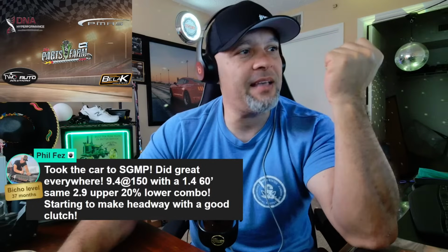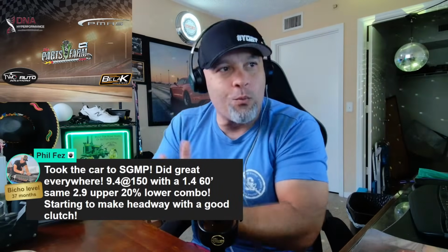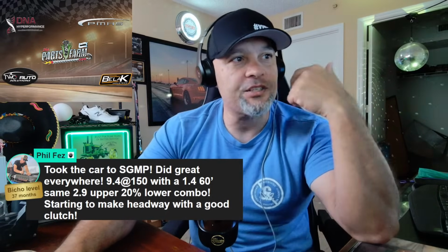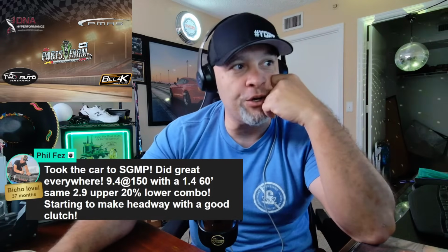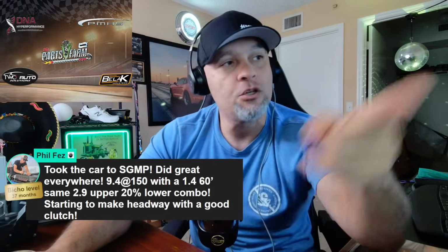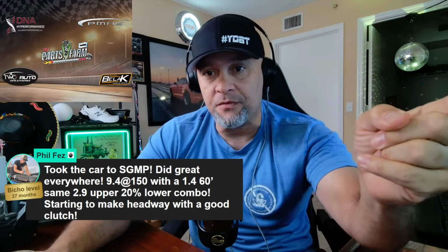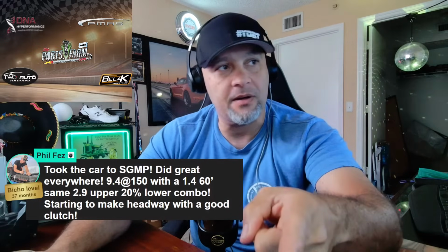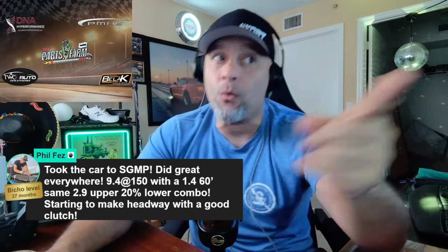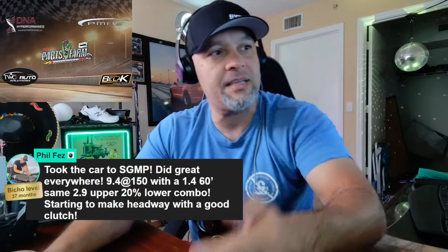Phil Fez: took the car to SGMP. Did great everywhere. 9.4 at 150. 1.4 60-foot. Same 2.9 upper, 20% lower. Starting to make headway with a good clutch. Get that thing on a 2.4 pulley tonight. You got the mile an hour. You got the 60-foot. You just need to front-half that motor. Or maybe the shifting needs some work, because a 1.4 and a 150 should have netted you an 8.90 pass. But you're there. Congratulations. I'd love to see it.